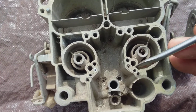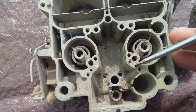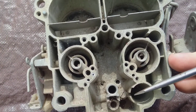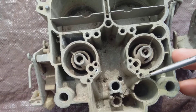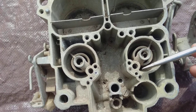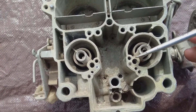The accelerator pump — I can't remember if it's this hole or this hole, it's one of them — corresponding to the accelerator pump passage in the cover that goes on top of the Q-Jet, there's sometimes a nub in the passage that restricts the flow. You need to take that out. Not every one of them has it.